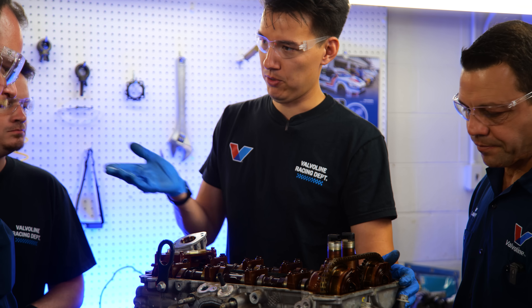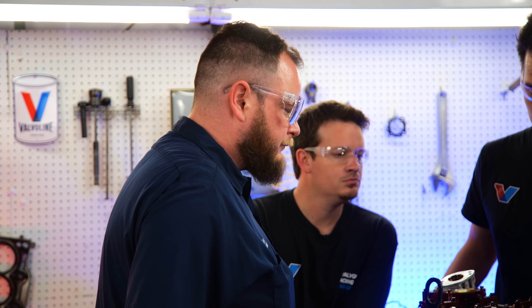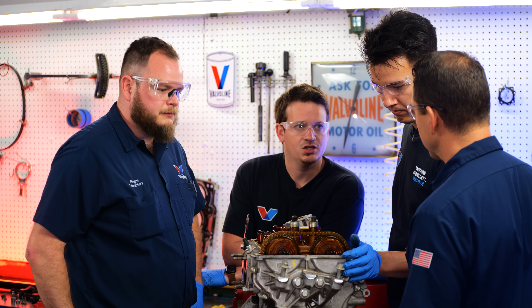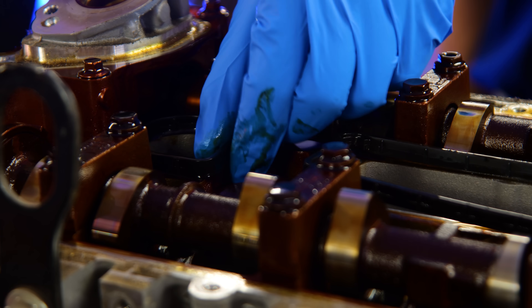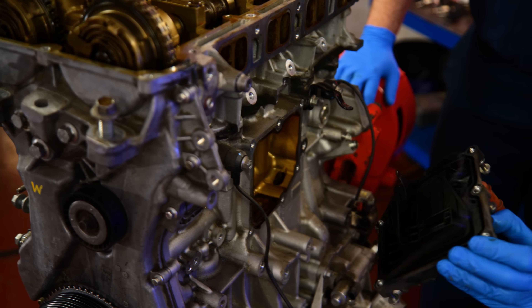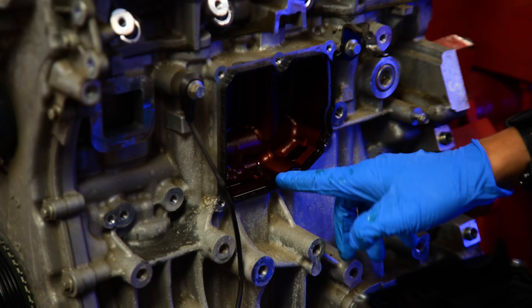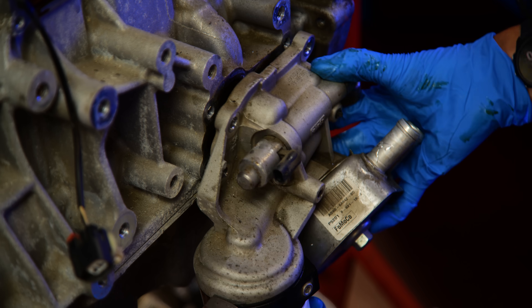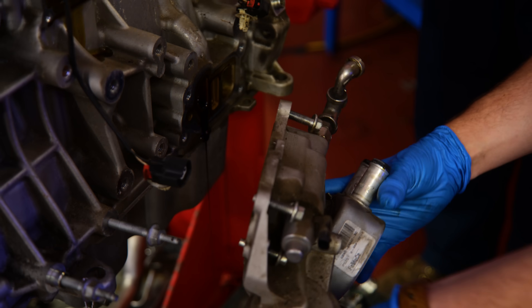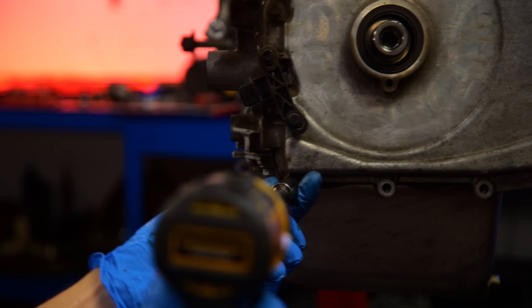What's the downside of varnish? Why do I care that it's red as opposed to OEM color? Well, it can actually insulate your parts, make them run hotter. It's building up like a coating — it can cause things to stick. Your buckets could start sticking. All three gaskets stayed on the head on this one versus clean removal on mine. We did extend out the drains on them, but we were sampling every thousand miles, so we kept that under control. It was very meticulous — probably much more stringent than the average consumer would do. A lot of people don't even check their oil level, and here we were checking level every eight hours.